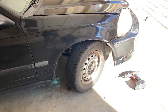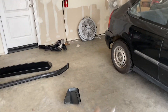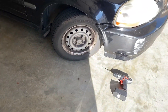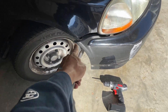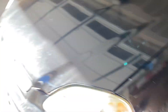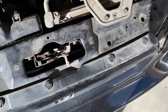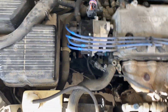I got the fronts on. I am waiting to do the rears because I want to put the rear lip on first to see how the mud flaps will fit with the rear lip. I am taking the front bumper off for the front lip — super easy, so far I've only taken out four bolts and it's already loose, which is always a good sign. It's just one bolt there, two at the bottom, one on the side, and then there are some clamps when you lift the hood up, and then they should be able to pop out and that'll be it — super easy to take the bumper off.